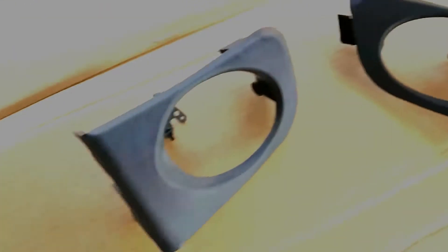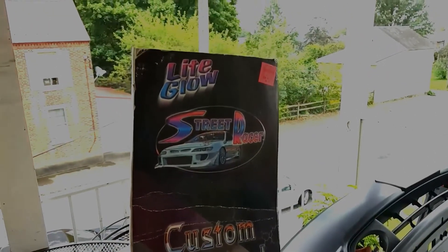I decided I'm going to paint the fog light bezels and caulk them in really well since the fitment wasn't good. I'm going to paint them red after I primer them — I just sanded one; this other one's not sanded yet. Hopefully they'll turn out nice. Once they're both dry I'm going to install them on the bumper. I pre-drilled two little holes on each side to put screws in, and also drilled through spots that only had holes on one side. They're installed — not going anywhere — and all primered.